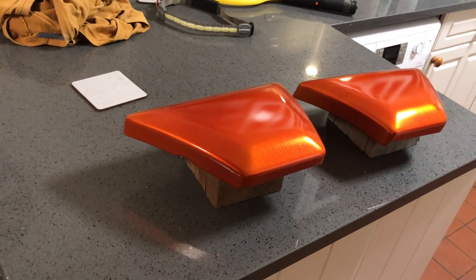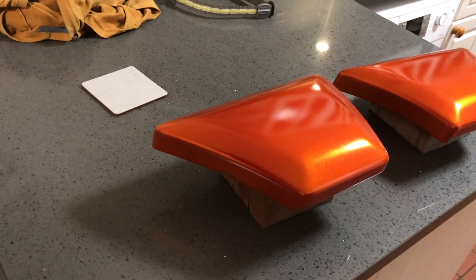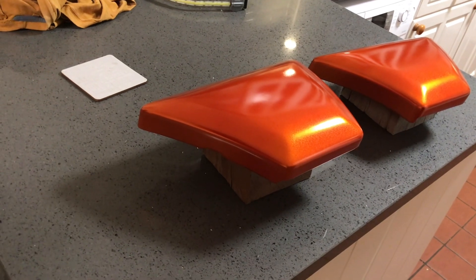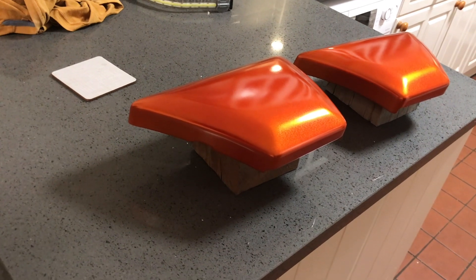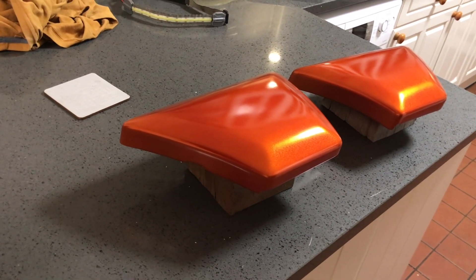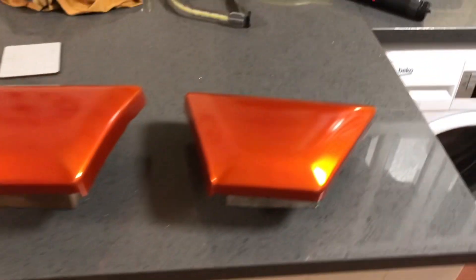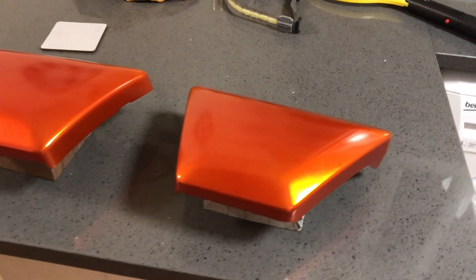I took my little nose fairing off, which is a damn good match for the tank, and brought it in. I used a daylight bulb in my little workshop to get the colour right and this is about four to five coats. I left 15 minutes between coats, so don't be tempted to rush. I am very very pleased with that result - to me it's a damn good match when you hold it up against the fairing, and that's without the lacquer. The lacquer will bring it down a bit and make it darker.